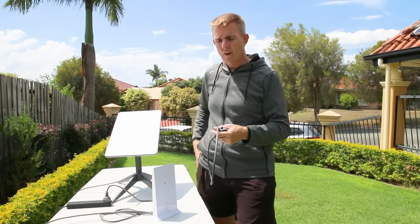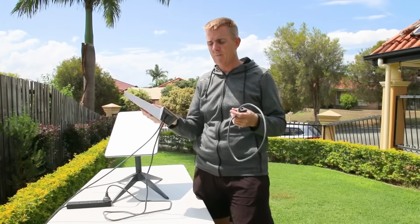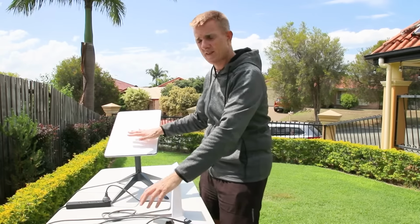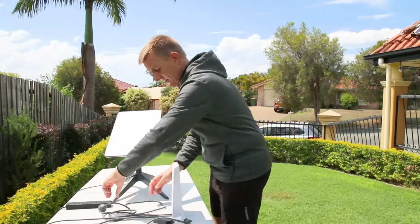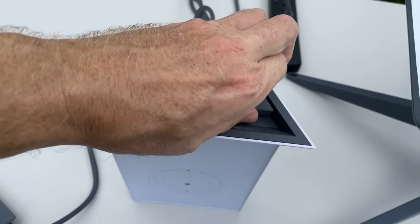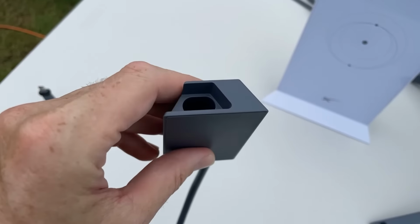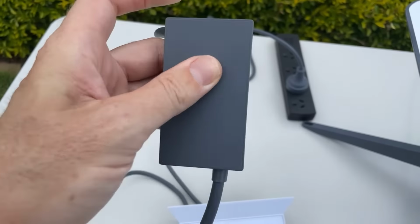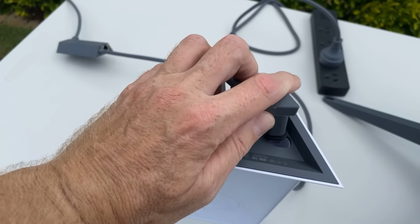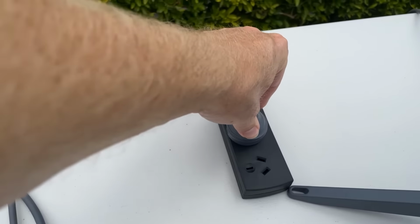So like I said, if you want to just keep this router, the router is going to be great for you. But if you want to extend it further, then we need to put our Ethernet adapter in line. So once we put this into stowed mode, we're just going to disconnect our power from here. And we're then going to take out our cable that's come down from our roof or wherever it's been mounted. And this is going to connect into this side of the Ethernet adapter. All right, and this gives us the ability just to extend on. And then we're just going to switch over to the back here and plug this now into our router. All right, and we should now be able to power everything back up again and give it a few minutes.